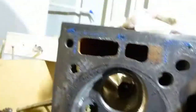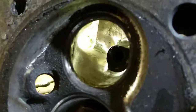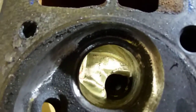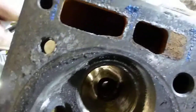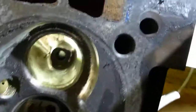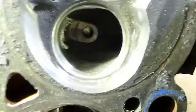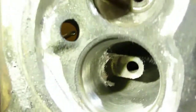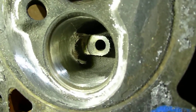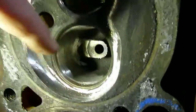Here's another one — I had a quick go on the exhaust yesterday. Nothing over the top, it's not the greatest port job, but it's had a fair bit taken out. If I was doing a quarter mile sort of setup, this whole section here would be taken right back. I've just swept out the back of the inlet chamber here — you can see I haven't touched the runner at all yet. But for an average sort of VN to VT with a bit of work, this is more than sufficient — just a bit of back bowl work.